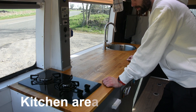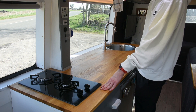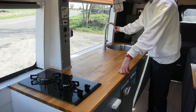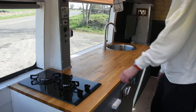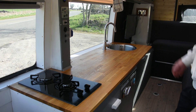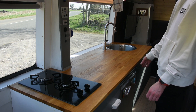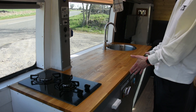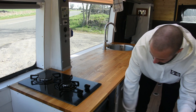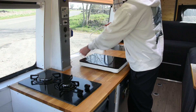This is one of my favourite bits of the van — the kitchen area. We opted for a massive amount of space relative to the van we got. We've got a double gas hob up the front, a Reginox sink at the back with a pull-out tap, and a nice big Dometic fridge freezer. For a family of five, it's always good to have a big freezer. That runs off 12 volt, or when we've got electrical hookup it will automatically detect the 230 volt feed and run off that as well. We also opted for an induction hob for when we've got electrical hookup, just so we're not utilising all our gas.